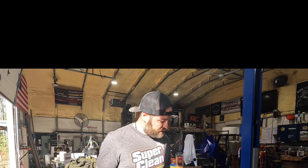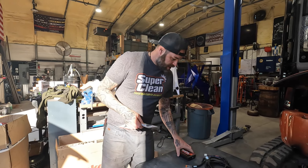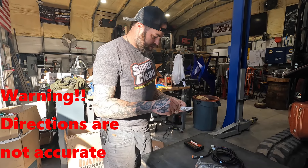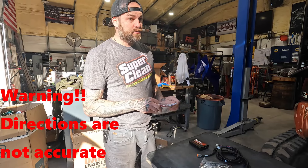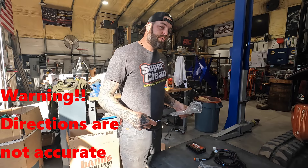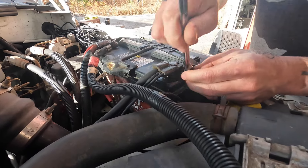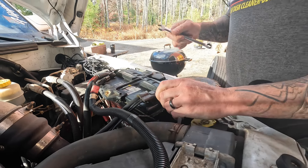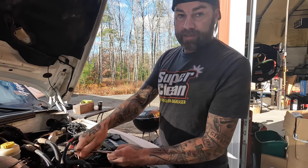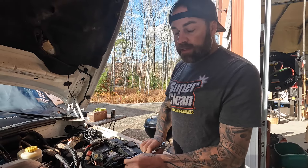We have a small part of the kit — it looks like a completely groomed-out wiring harness that does appear to be plug-and-play, but I don't know that it is all plug-and-play because there's some taps here. I'm going to quickly do a little direction read and see where we're at. Caleb's doing the recording today, so it's not just me holding the camera. First things first — anytime you're going to be doing anything electronic, disconnect your ground cable. This thing has two batteries, so both of them. You're going to lose your radio and everything else, but do yourself a favor. Same thing if you're welding on a vehicle — disconnect the ground.